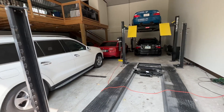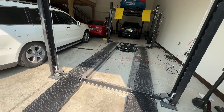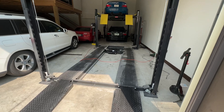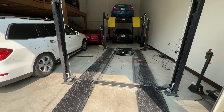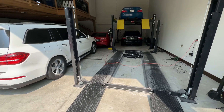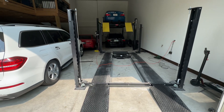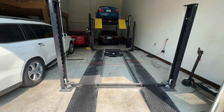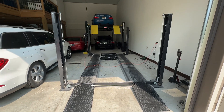I've got a few things I'd like to get done this weekend. First one being the starter solenoid on the Lamborghini, and then probably an oil change. It hasn't done many miles since the last oil service — I know who did it and what oil was in it, but I haven't done analysis. The starter started acting up late last year where you'd turn the key, nothing, three or four times, and it would fire right up. Starter sounds strong when it works, so in my opinion that's the solenoid — the device that handles transmission of current between the battery and the starter — going bad, not the starter itself, which is great because the starter is like $2,300 and a solenoid is $80.